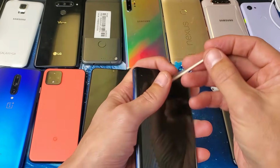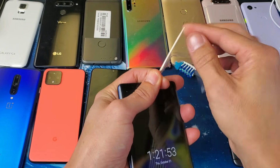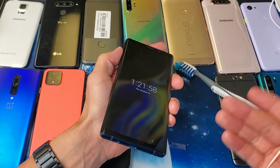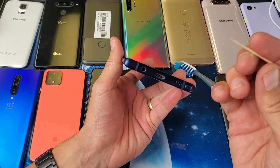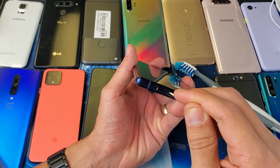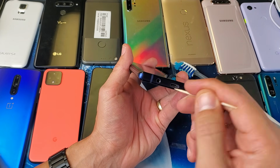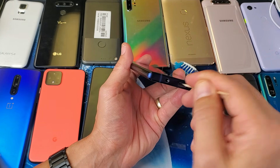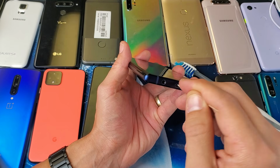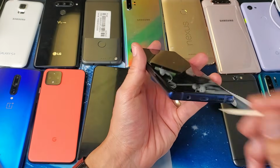And then if you have a toothpick, go ahead and do the toothpick too. Grab yourself a wooden toothpick or a plastic toothpick. I've used metal paper clips, but you really should not use metal things in here. Okay, anyways, here's a toothpick. With a toothpick, you kind of want to dig in there a little bit. Sometimes you'll be able to see a little lint ball and you can pry it out, but keep moving that around in here. Sometimes you can have a soda or coffee stain in there that's not letting it charge at full capacity. And then blow it in just like that.